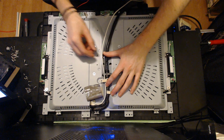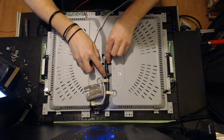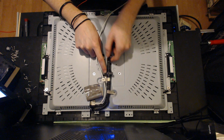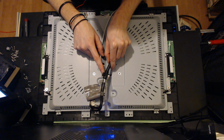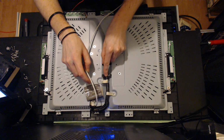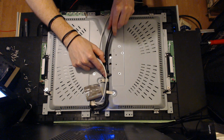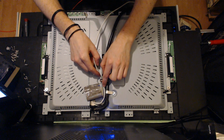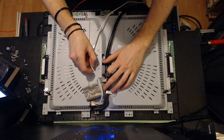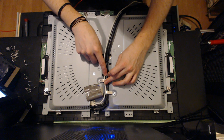And the way that the plastic shell sits on this, it sits flush against this piece. You see this piece here has some cutouts on it. You can see they sit on some raised metal tabs. It's just a strain relief design, so the cable doesn't pull vertically with use. So you want to make sure those sit on there. And you won't be able to just lay it across and get the plastic shell on.